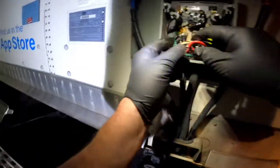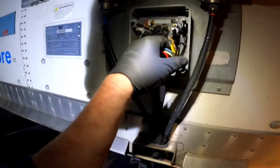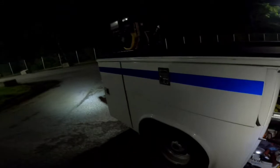Alright, well the wires look good. Should have checked to see if there was a draw. Wire's tight. That's a little loose. Alright, let me get a driver and just double check the tightness on them. If they're any way loose, it can have a bad connection. If not, then I'll have to put it on my box and see if there's a draw on that turn signal.